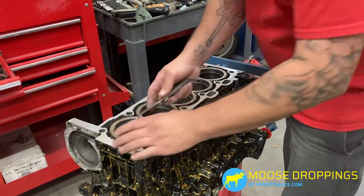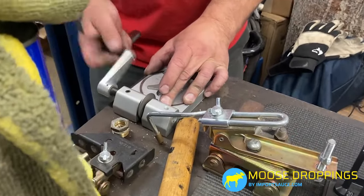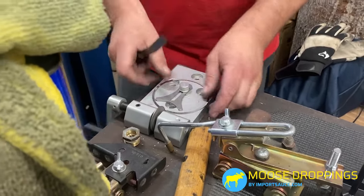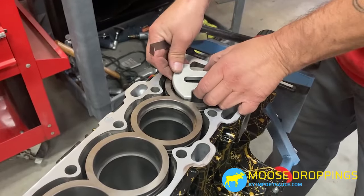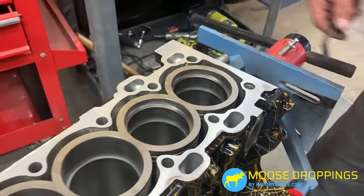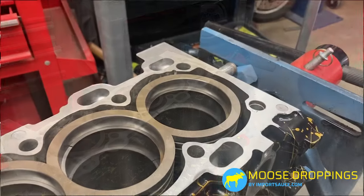The first five rings were perfect to spec right out of the box. We did find one ring gap that was a little less than needed, so we used this ring filing tool to open it up and match what Vita and Wiseco specified. After just a small amount of grinding, we stick it back in the cylinder, seat it at the proper depth to get an accurate measurement, check it, and if we need to grind a little more we do — if it's perfect we move on.